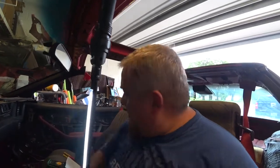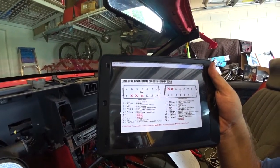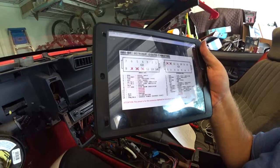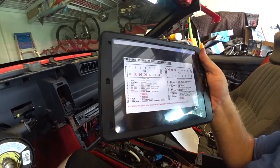We're de-pinning our things here, our clips, and I wanna kind of show you what I'm working off of. So I found this C1 and C2. C2 is on the left slash driver side, and C1 is on the right side, and I'll be using this as my template. So what I'm depinning are the speed input, the ground. I don't need the oil pressure. I need the fuel gauge. The right indicator, left indicator, I need those. The high beam indicator and illumination, and then gauge power. I'll be depinning all of those,